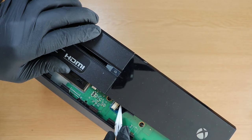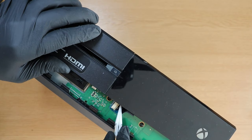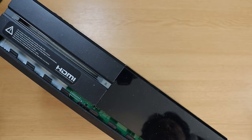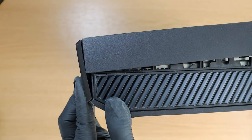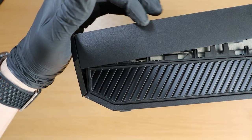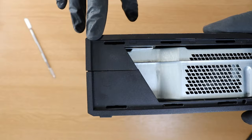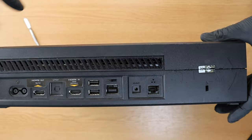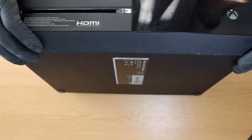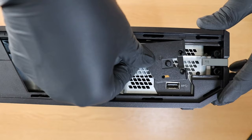This is the part where we need to put the ribbon cable back. Getting the angle for this was horrible. As I explained earlier, just get your prying tool, make sure the ribbon is correctly attached with the blue on the outside. Make sure to tuck it in properly and then with the prying tool just push the plastic bits in to secure the ribbon cable. Putting the last shell back on can be deemed as the hardest bit. Make sure that all the clips at the front line up and it sits flush. Then work your way to the side of the Xbox opposite to the grill that we removed at the start. It will take some force, but you'll need to pull the shell over a clip on the corner. You'll know if it's not sitting properly because of the gaps around the Xbox. You will not get this right the first time you try - trust me.